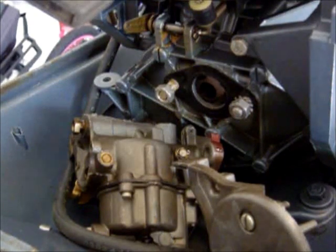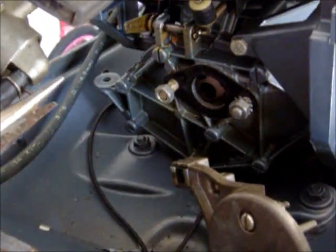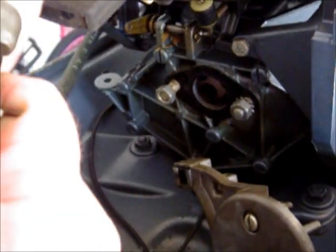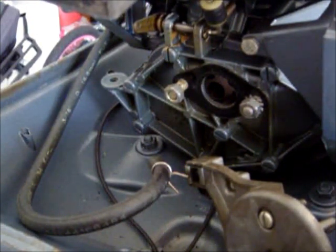I'm going to go ahead and remove — adjust this back just like this. It should be off of the fuel nipple; I'm just pulling it off here. There we go. The hose going to this is a 3/16th hose coming from the fuel pump. I've got this off, and this carb looks pretty clean, but that doesn't tell us what's inside. I'm going to turn this off and restart when I get everything ready on the bench.